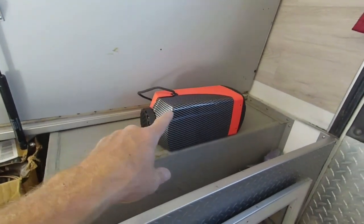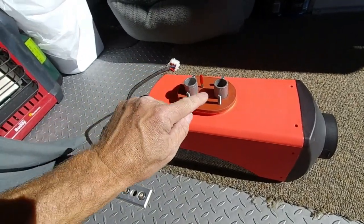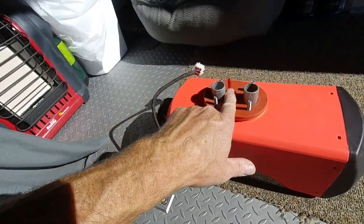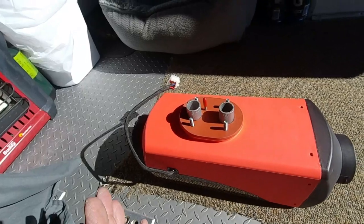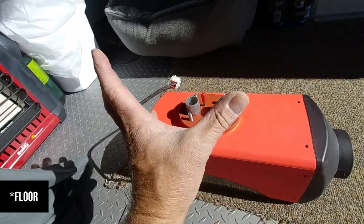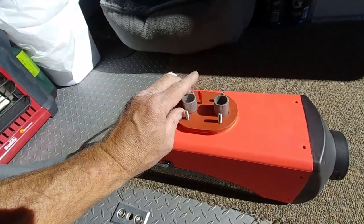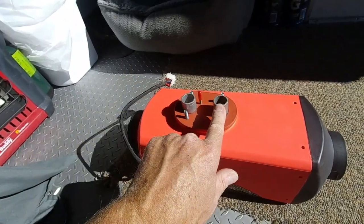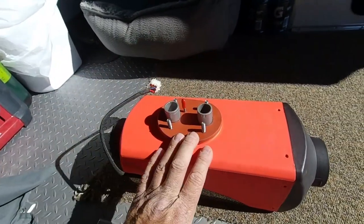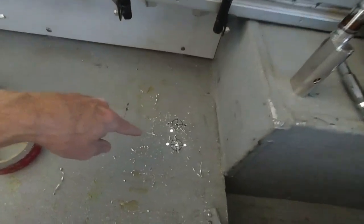No propane moisture — safe, dry heat. So this is a rubber gasket and these are the four mounting bolts. I've got to drill a hole for the fuel line and four mounting holes, and then this thing will suck right up against the wall with nuts on the other side. It's going to be really tight. On the other side of the wall I've got the exhaust pipe and the air intake pipe, and they have clamps so there's going to be no leaking.